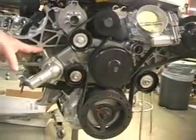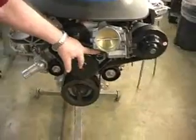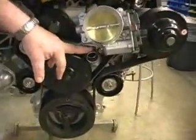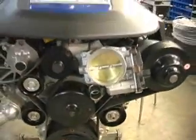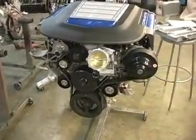Notice the water pump is totally changed. On your 2009 motors you'll see the throttle body has changed even on the LS3s and 7s, and the top water pump outlet comes out on the driver's side again, where all the earlier motors have had it on the passenger side for years. So there's a lot of changes in '09.